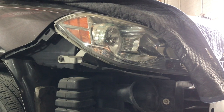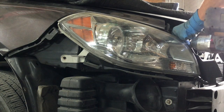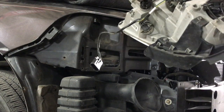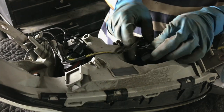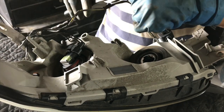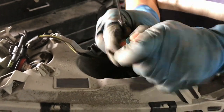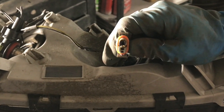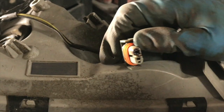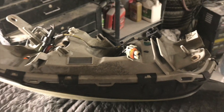Let's go to the other side — same process on the right side. You can take the bulb out whichever way is easier, but there's always a tool that can help. This is what I had to do because the bulb didn't want to come out. Look at this — the terminals are all burnt out, the plastic has melted. This one was 65 watts. You never know — another good reason why we should convert to LED.